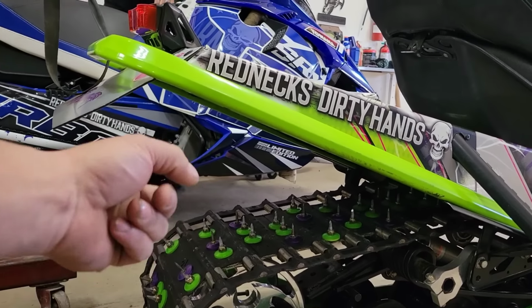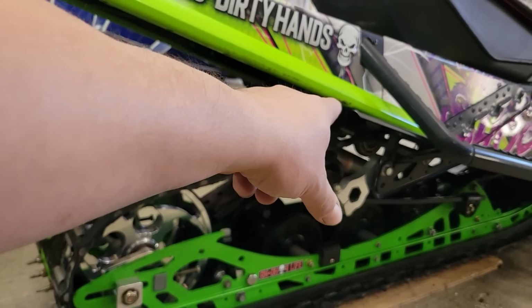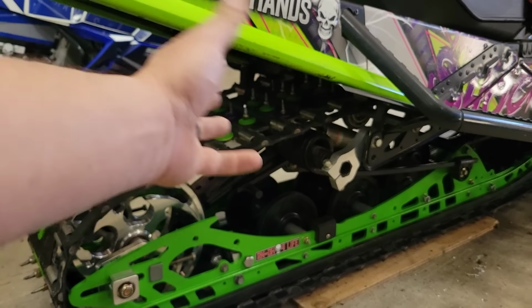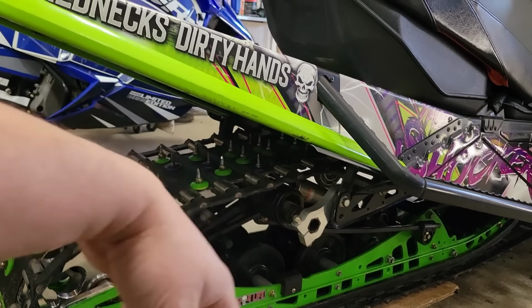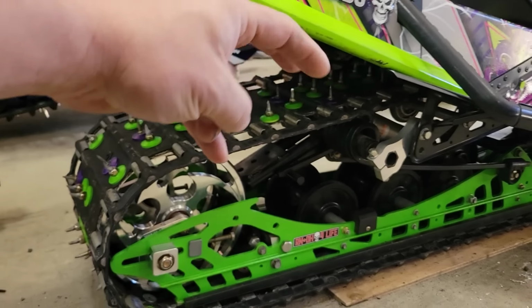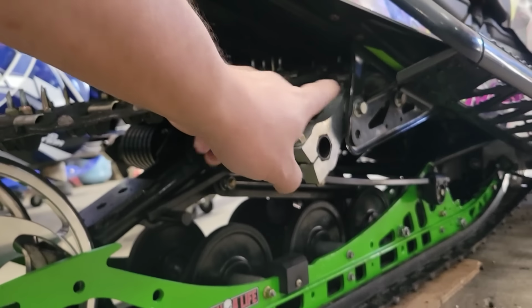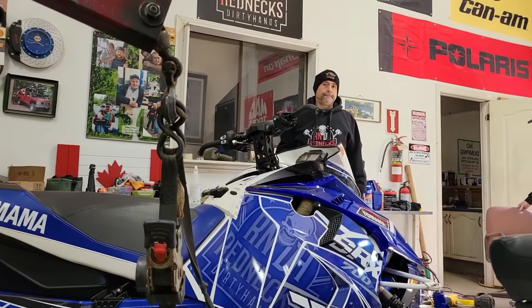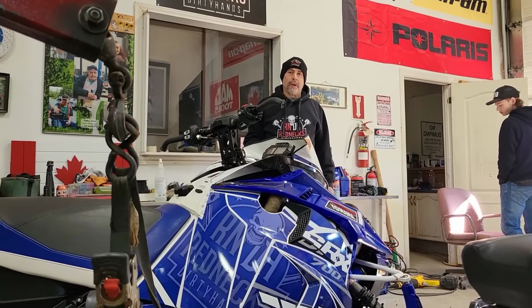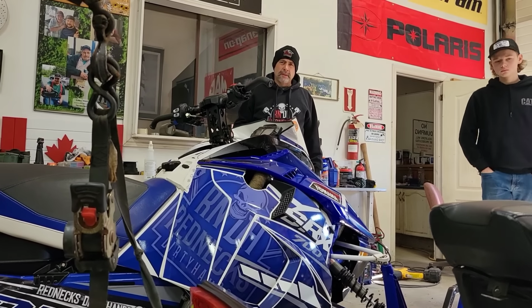Some people, after I posted that short of cutting this down with the skill saw, were commenting, you know, what about those top wheels there? Because normally you got wheels on there that hold the track up off the suspension. Well, again, with some slight modifications, we got the suspension sack down, and then I made a bar that goes across, and I got two little idler wheels. I think it was off a Yamaha suspension we found out in the yard, eh? Yeah, like an RX-1 or something like that, Apex? Yeah, I think it was an old RX-1 skid or something.